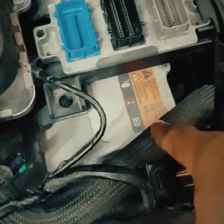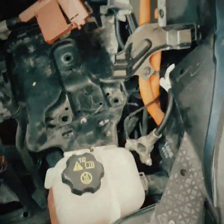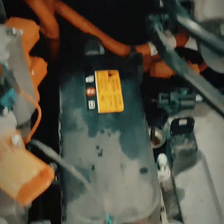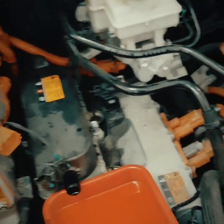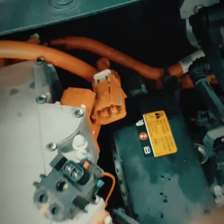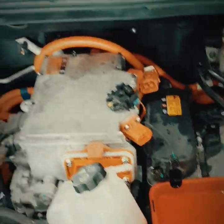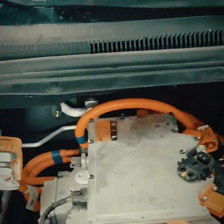As you can see, this is our charger under there. You've got to remove the ECM and then remove and replace this EV charger. Make sure when you pull these coolant hoses you catch your coolant. I forgot to mention - when pulling these clips, the instructions are on the clip: one, two, three. The instructions are right there on a GM electric vehicle. Slowly take everything apart, remember where you took everything from, and it should be no problem.